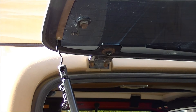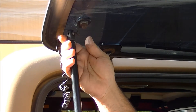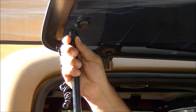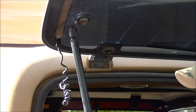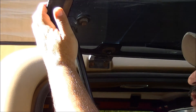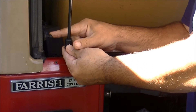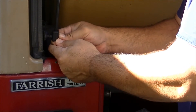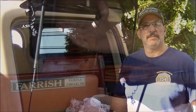To replace your lift support or strut: the spring, you don't have to touch on this one — just snap it in place and it's in there; that spring will hold the tension on it. Then for the bottom, you might have to compress it a little bit and orient it with that nub or stud, then push up a little bit to get it to line up, push it in, and you're good.